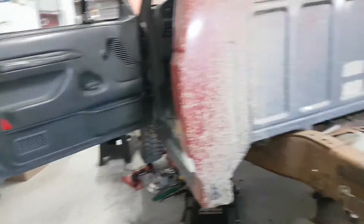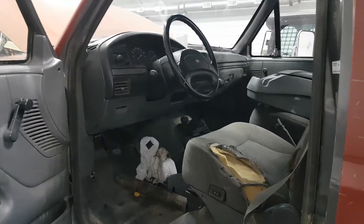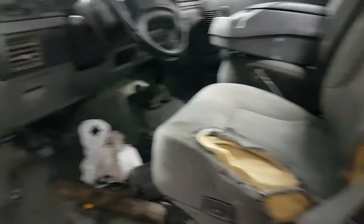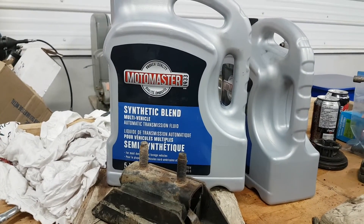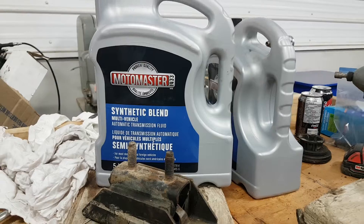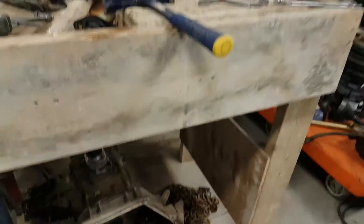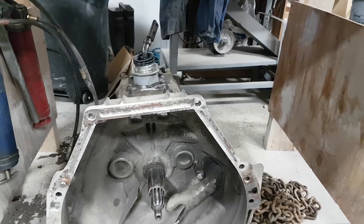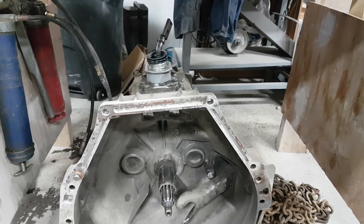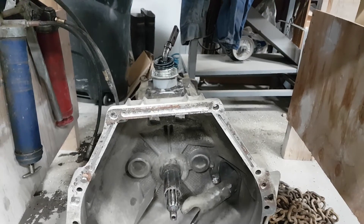The reason I took the transmission out of this truck was that the synchro mesh in second gear was blown out — really common from what I see in the forums. I'm running a synthetic blend in the replacement transmission. The case on it looked pretty ugly, so I'm running a cheap fluid for a break-in period, then I'll drain it and put better stuff in. The old transmission had gear oil in it, and that heavy fluid causes drag on your synchro meshes which seems to throw the timing off and wear out your synchros prematurely.